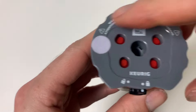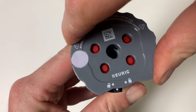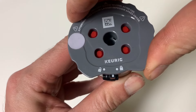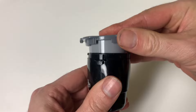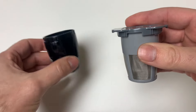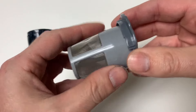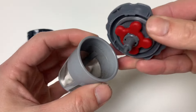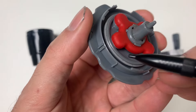Taking a quick look at the filter assembly: there is the lid, which you rotate counterclockwise to unlock and clockwise to lock. Let's rotate it counterclockwise to unlock it and remove it. Now the lid and the filter basket are removed from the filter holder, and the lid and filter basket are separated by pulling them apart. They are just held together with an interference fit created by a rubber gasket.